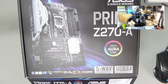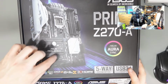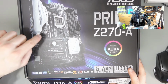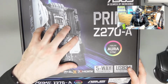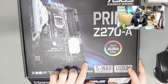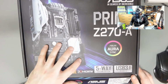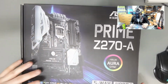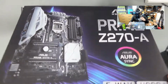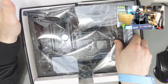It's got, I don't know if you can see here, 3 GPU ports here, but it's got a lot of X1 ports, so there's a total of 7 here, which means that you can put 7 graphics cards. But because you can use an adapter for the M2 port, you can actually increase this and put 8 GPUs on this motherboard, and it's supported in the BIOS. And that's what I've actually got in my 1060 rigs. I've got 8 GPUs in each one.